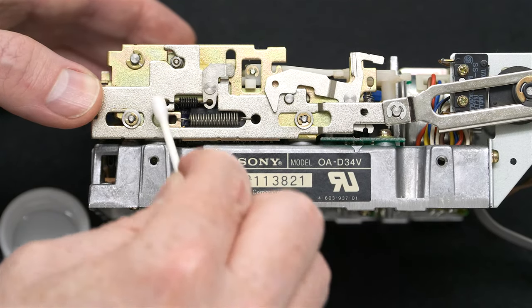When putting the drive back in the sled, try not to get your hands over here. You don't want to touch this and get your hands all gunked up there. Also, remember that we need to put the drive in with the circuit board up. Okay. And the ribbon cable is facing this way, which is opposite this. You can see there's a gap here. The ribbon cable must go in that way.